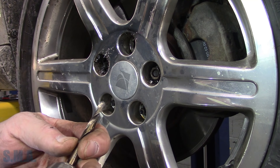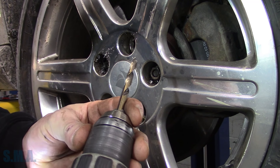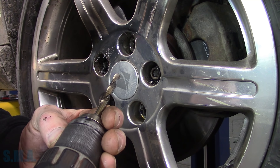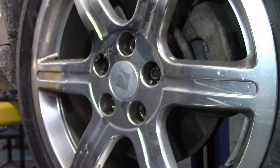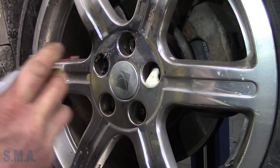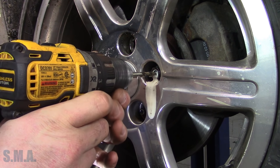Now I know it sounds like a silly tip, however, it works. I'm starting out with a — I don't even know what size — smaller, looks like something 13/64ths maybe. A Matco Hyperstep Cobalt drill bit — not a sponsor. We'll give it a spritz of some sort of lube; doesn't have to be special drill bit lube. And then we're just going to go at it.